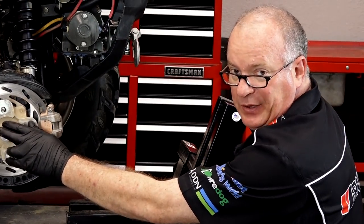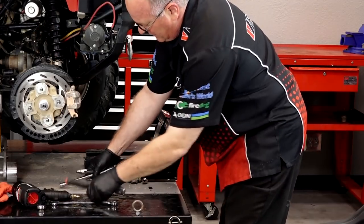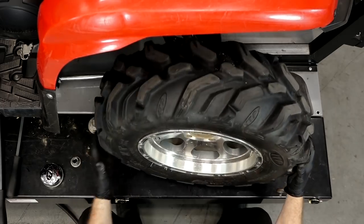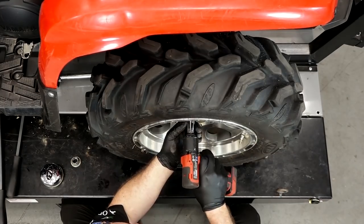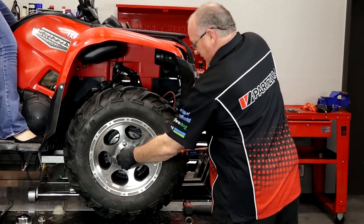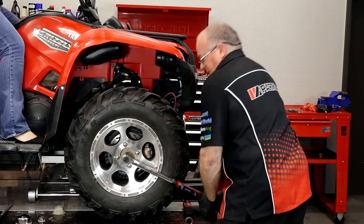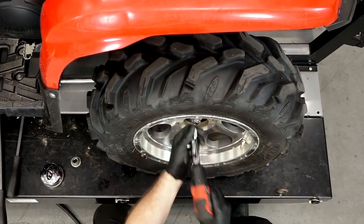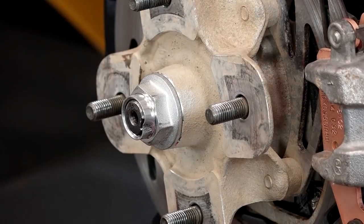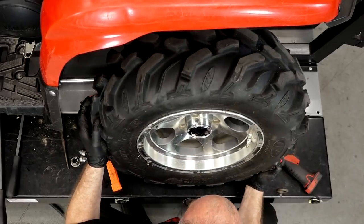This guy right here has to have 190 foot pounds on it, so what I'm going to do is get all these tools out of the way, take off my center cap on the wheel itself, remount it, drop it down, put it in park, hold the brakes, and have it sitting on the ground — and that should be enough to hold it still to bring it around to 190 foot pounds. Take the tire back off, then we can stake it, put the cap back on, and finish it up. Now 40 pounds on the lug nuts.